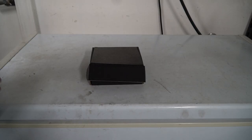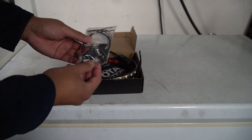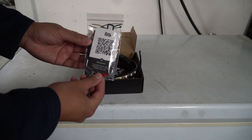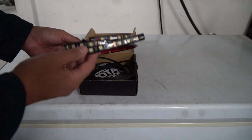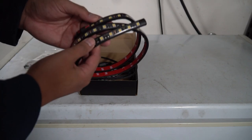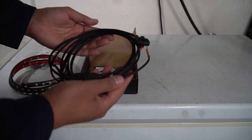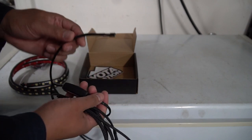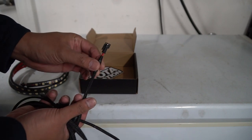Let's take a look at what's inside the box. It comes with a hood pin to turn off the light when the hood is closed, zip ties, and zip tie mounts for the wiring. You can scan the QR code for installation instructions. The 40-inch LED light strip uses 5050 LEDs and should output over 1300 lumens. It also comes with a wiring harness — a single eye terminal that hooks up to the battery, with the other side connecting to the hood pin switch for the ground, and then to the LED itself.